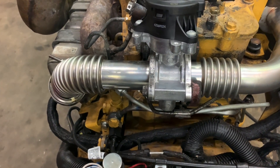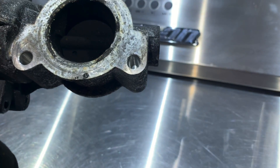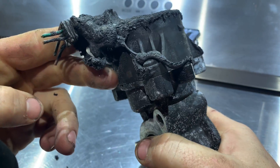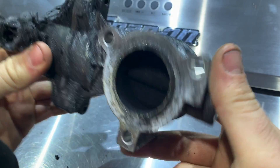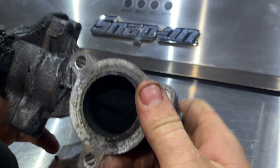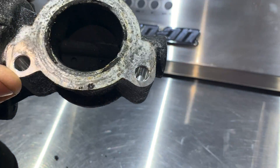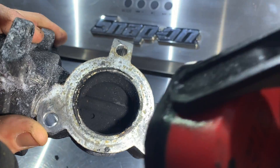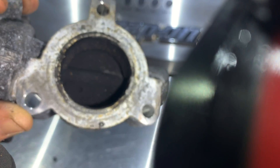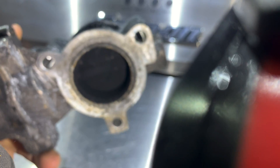Let's check out the old one and I'll show you what that one looked like. This is the old EGR valve. It's really not that horrible as far as the valve went, but it did have some fire damage, so we're replacing it. This is what the carbon looked like inside of it. The EGR valve is a butterfly-style valve, and it has carbon in it — I don't know if you guys can see that carbon. It's really not that dirty.